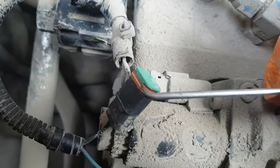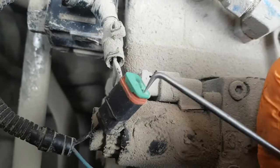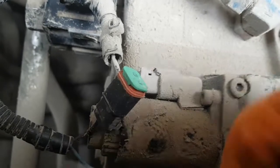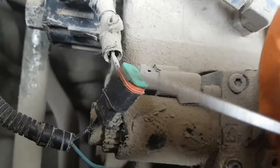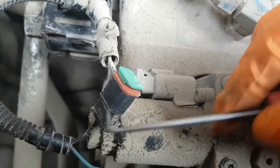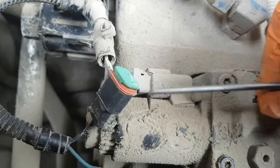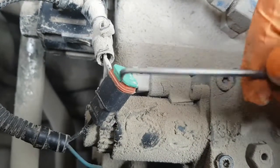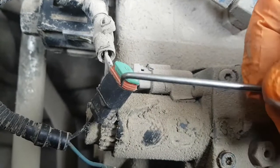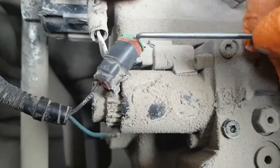I like to press down even further and give it a double crimp. Nice pick. Take this lock off, and again there. You've got your other locks holding your Deutsch connectors. Just pull them out. I like to use a little bit of WD-40 or whatever to put them back in afterwards, give it a little bit of slippage right here. It's nice and easy to take back in and out. Pretty straightforward, pretty common stuff.